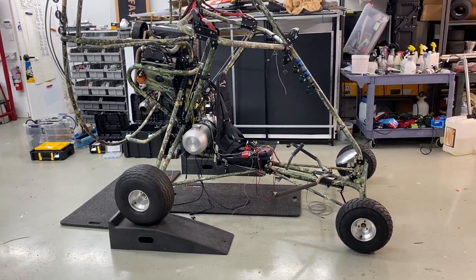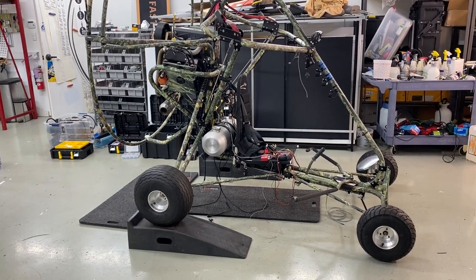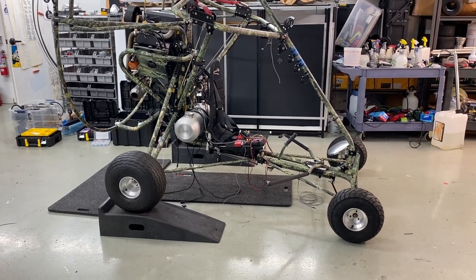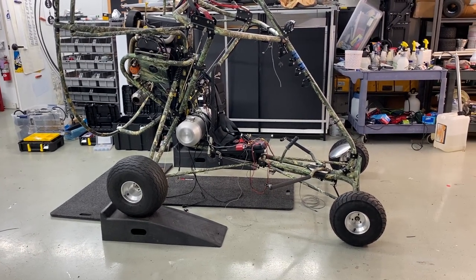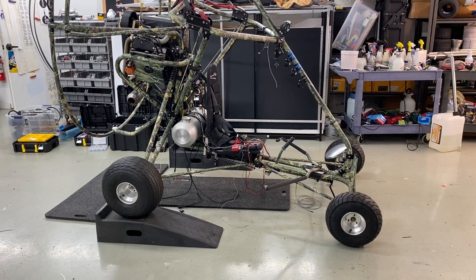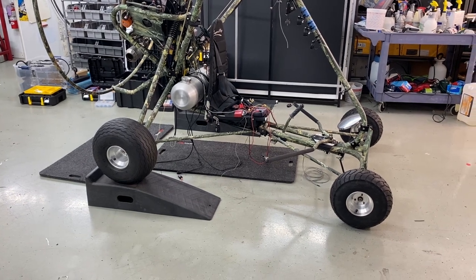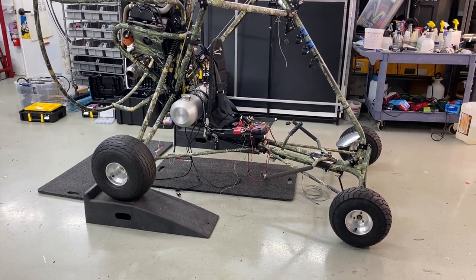One of the first things I've done is the wheels — I definitely didn't like the original Azusa light plastic rims. On the rear you can see typical tundra tires: Hagar rims with Carlisle tires. I didn't like the look of those on the front — too much like a beach buggy — so those are mini bike wheels on the front. We may end up putting matching tundra tires on the front as well to help with weight and balance.